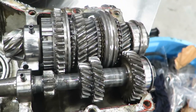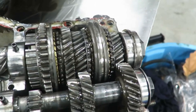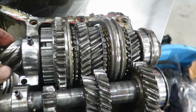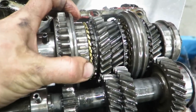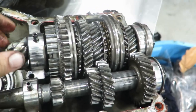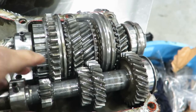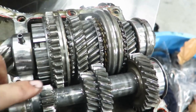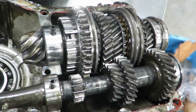I was just packing this up and thought this might be an easier way to explain it. With constant mesh, these three gears are constantly in mesh but they can turn independently because nothing is actually selected. Whereas first gear is not constantly in mesh - so when the input shaft's turning, you put your foot on the clutch, everything in theory stops, and you select first and you've got first gear. Of course when you're moving, the shafts are turning - this one at road speed. You let your foot off the clutch and this one essentially slows down while this one is still going at road speed, so you've got to try and time the two so they can go into gear. That's where a lot of this damage happens - people just jam them back in, it crunches away and they hope for the best. Anyway, I thought that might make it a bit clearer.